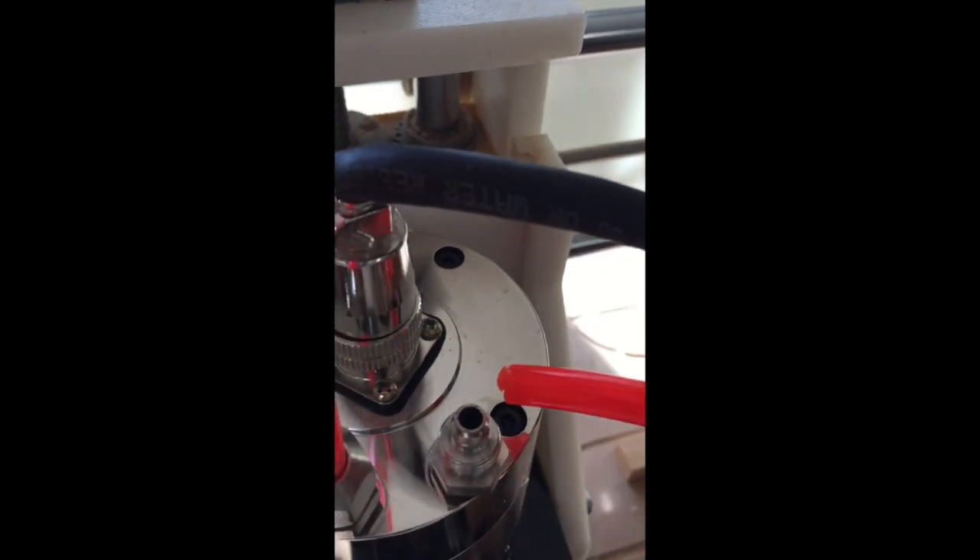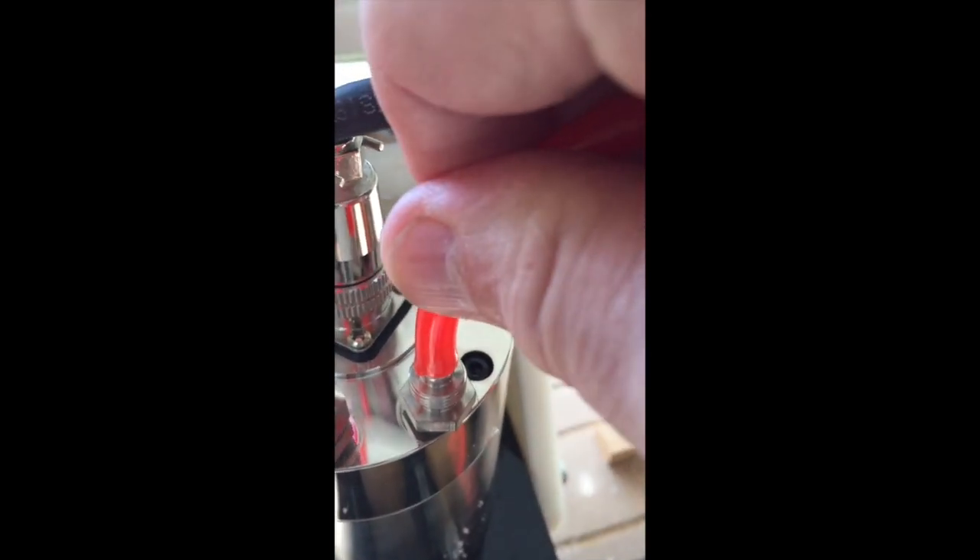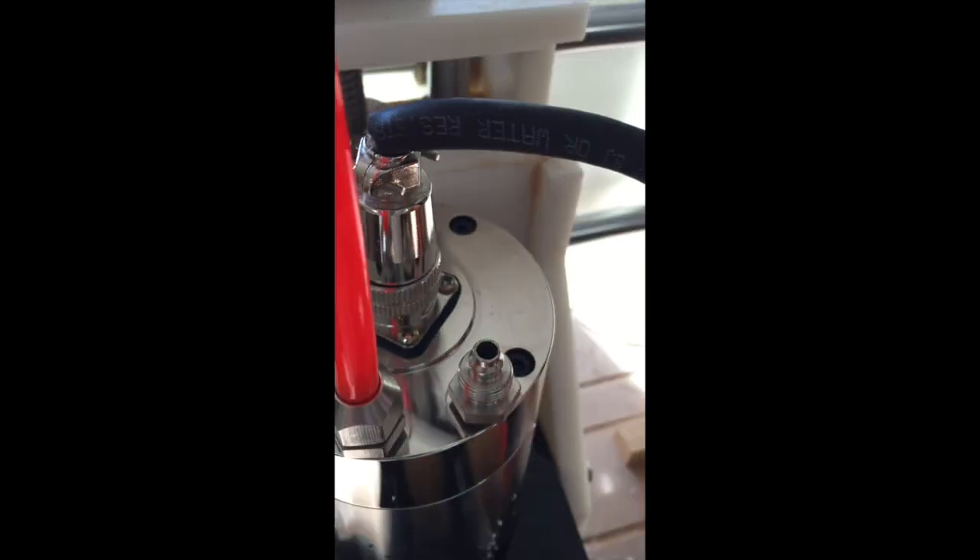Now I'm going to fit this hose on here — you'll notice it doesn't really fit. My trick is to stretch it a little bit using a pair of needle-nose pliers inserted inside the hose end. You can see how the needle-nose pliers stretch it, and after that you can slide it onto the fitting.